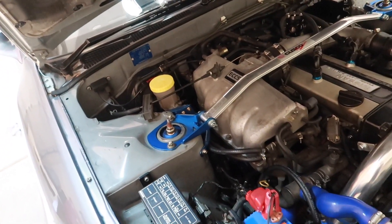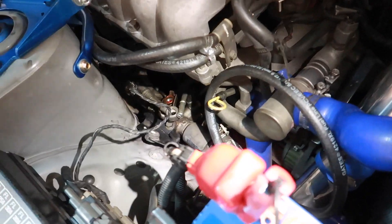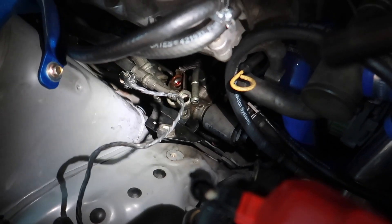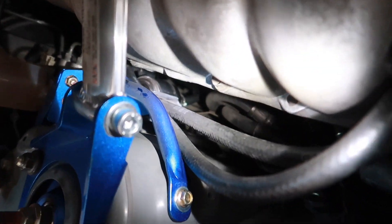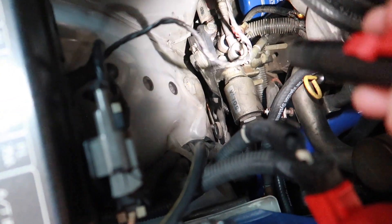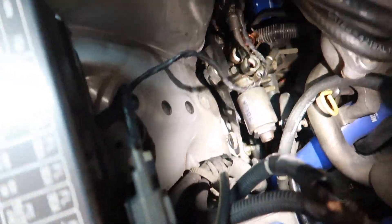Once you work your way up to the engine bay, taking out the hard lines from the chassis brackets, you can go into the engine bay and start to remove the HICAS pump. The HICAS pump is connected to a bracket, and to remove that bracket you'll need three 10 millimeter bolts — one here, one easily exposed, and the third underneath the fuel filter. A ratchet wrench helped a lot there. The banjo bolts to the HICAS were a 14 millimeter — go ahead and zip those off to remove the banjo lines completely. Have an oil pan underneath the car because it will leak quite a bit.